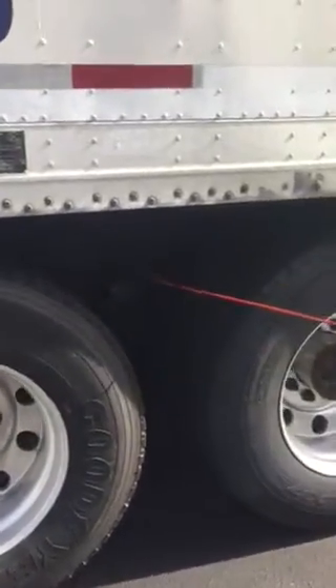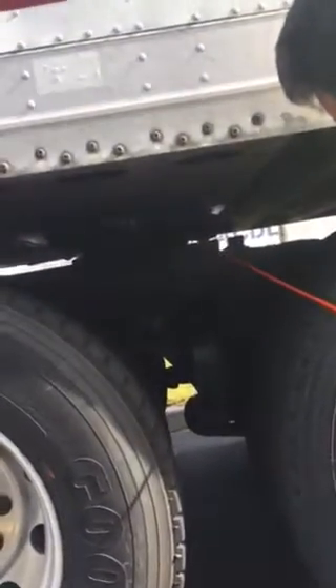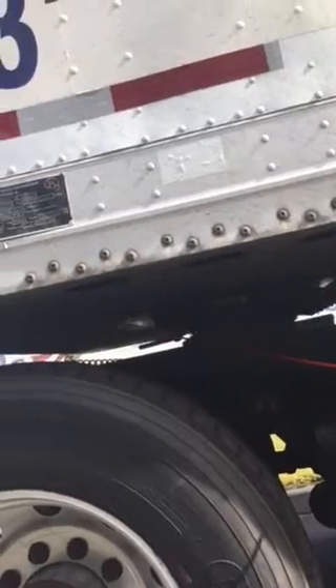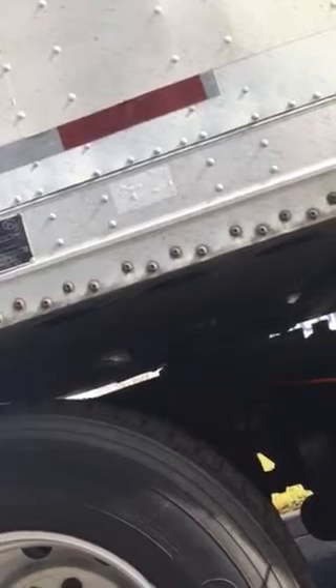From there, I'm going to move on to my coupling system. My apron is not bent, cracked, or broken. My fifth wheel is not bent, cracked, or broken — it's properly greased, and there's no space in between the two. My kingpin is not bent, cracked, or broken. My locking jaws are locked around the shank of the kingpin and not the head of the kingpin. My pivot pin is secured and properly lubricated. My fifth wheel release arm and safety latch is not bent, cracked, or broken, missing nuts, bolts, or screws, and it is in the locked position. My platform is not bent, cracked, or broken, missing nuts, bolts, or screws — there are no holes or welds other than factory, and all of the mounting bolts are there. My sliding fifth wheel locking pins are in the locked position.